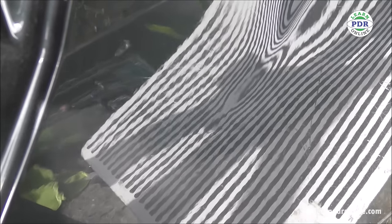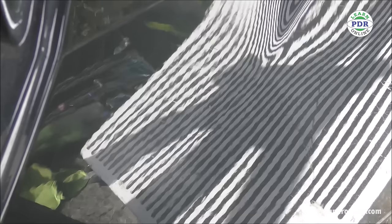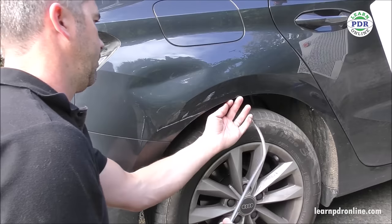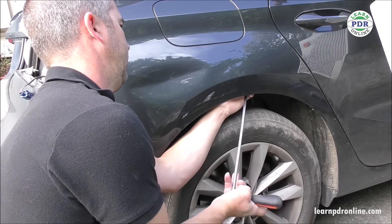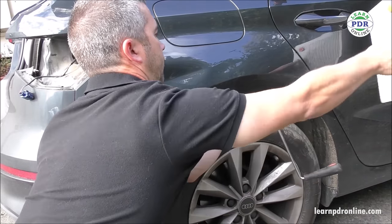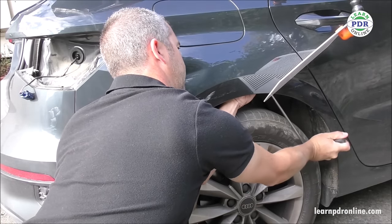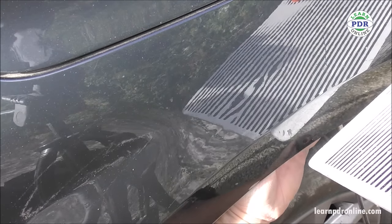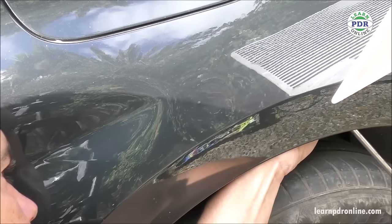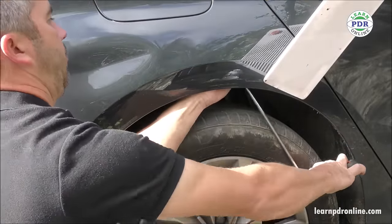You can see the lines pinching together as my tool tip connects right into the centre. As I speed up this repair process, you can see the way that metal moves and comes back into the correct shape. Now that I've tidied up the tail of the crease on the rear, I'm going to go through the other access point under the wheel arch and do the same for the front end of that crease. At this stage I'm looking to take out the left and right damage to about 90%, to give me a true shape to the panel, release any crowns and tensions leading into the middle of the main bulk of the dent, leaving me with just one big dent to work with.